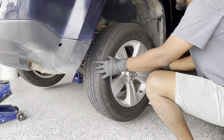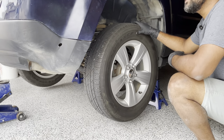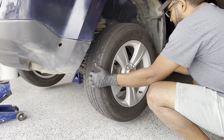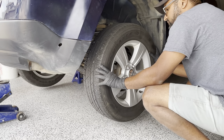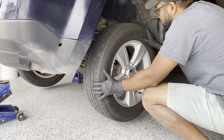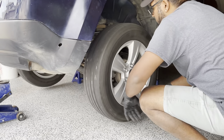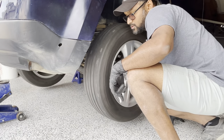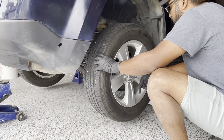To check a wheel bearing, there are three ways. This one has an ABS sensor, so if the ABS light is on, that's one sign the wheel bearing is gone. You can put your hands at nine and three o'clock and move — if there's movement, that's another sign. Sometimes even if the bearing is bad you won't feel that, so the next thing is you can rotate the wheel and listen for any grinding noise. You can hear how loud the noise is.